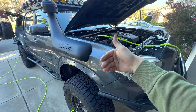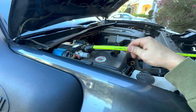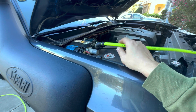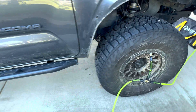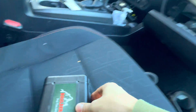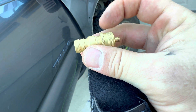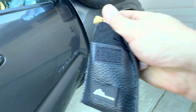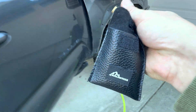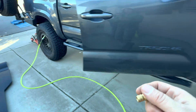I'm going to unplug it all, deflate it, and then inflate it after that, just to show you guys how fast it deflates and inflates with this product, because this is a faster, larger-bore hose, so everything should be a little bit faster. This isn't how I normally deflate, but I usually need to help people deflate — not everybody has a deflating system. This is what I typically use to deflate. You just screw them onto your wheel and you can set the PSI based on how much you back this cap out. I'll put a link in the description below.